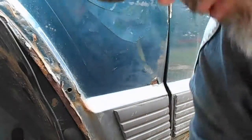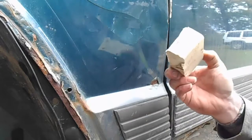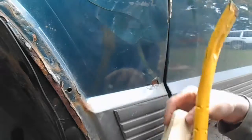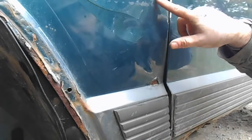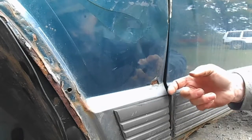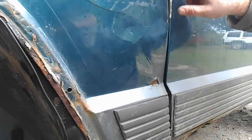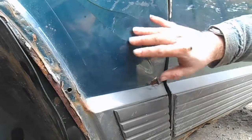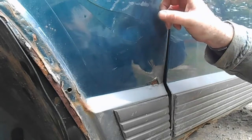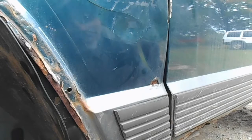To reach way up there I had to use a block of wood on the inside on the A-pillar part and just use that as a fulcrum to get the leverage I needed to pop this top one out. It's looking pretty good. I might work on it a little more down here — see if I can get that line out. I don't want to use body filler along this edge; I want this edge to be all metal. And all the paintless body work guys are going 'oh man, you're ruining it' — well, it's all coming off anyways, it's going flat black.